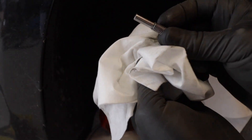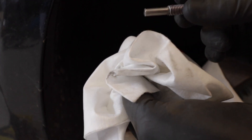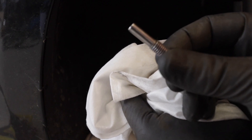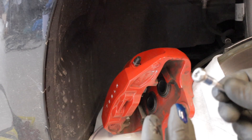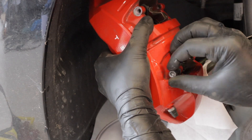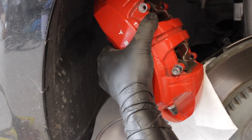Have some brake cleaner on a cloth and just get the grease off these pins so we are good as new. If there's anything burned you can just use a steel brush or brass brush carefully to take it off, but the best way is just to use brake cleaner. On these pins we are going to use some Loctite — just apply some Loctite, that was a little bit much but just like that. First pad, just align it, and we'll do the same thing with the other bolt.